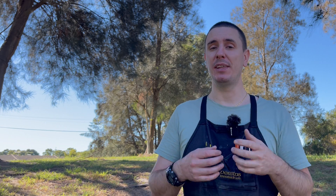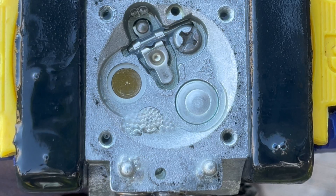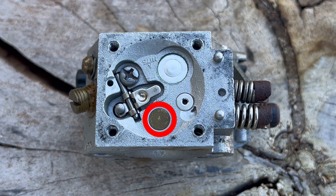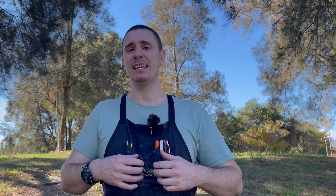The last test we're going to do is for the Welsh plugs. If we see any air bubbles coming around those we know they're leaking and must be replaced. By taking that bristle out of the purge check valve we can test to see if that is functioning correctly as well. We're getting those bubbles again, so both the main nozzle and purge check valves are either dirty with debris and stale fuel holding them open, or they're no longer sealing effectively — no longer pliable and flexible like they once were.